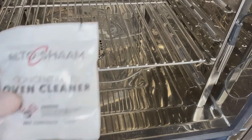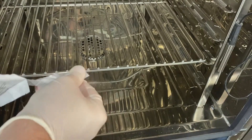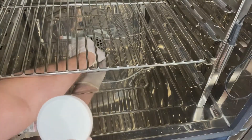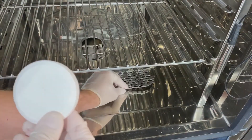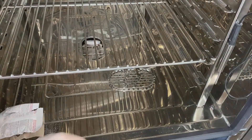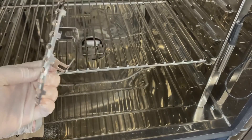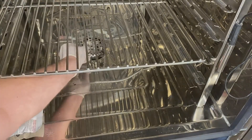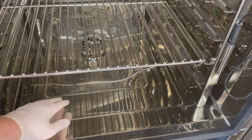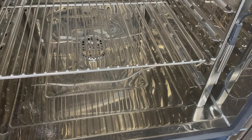Placing the tablets in the oven is the same as with the previous version. Wearing gloves as PPE, rip open the bag along the seal and lift out the tablet. Lifting the drain catch up and out of the oven, drop the tablet down into the drain. After putting the prescribed number of tablets down the drain, put the drain cover back on top of the drain catch, push down and it will clip in place, then close the oven door and start the cleaning process. If you only put the tablets on the bottom of the oven and not down the drain, there's not enough water to properly dissolve them and you won't get the best cleaning result.